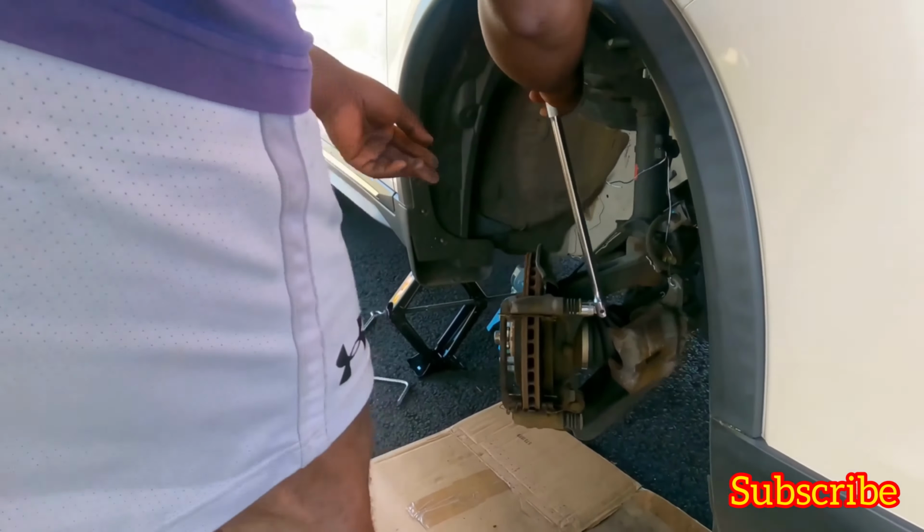So there's usually a little grease on the new rotor. They put it on to protect it from rust if it doesn't sell right away. So brake cleaner, take it off to make sure you get good braking right away when you start driving. Okay, let's put it on. Okay, can leave it on for now. Now let's clean up the bracket.